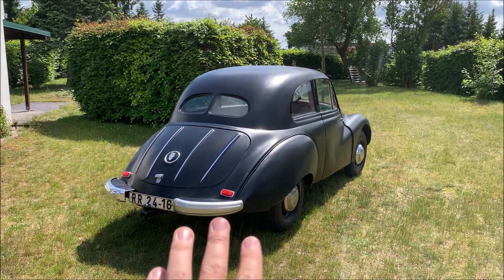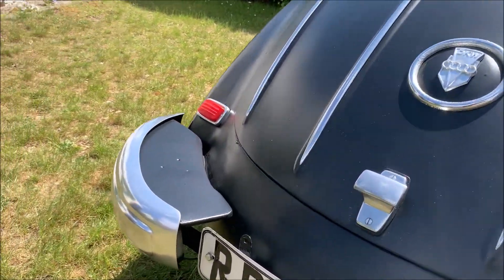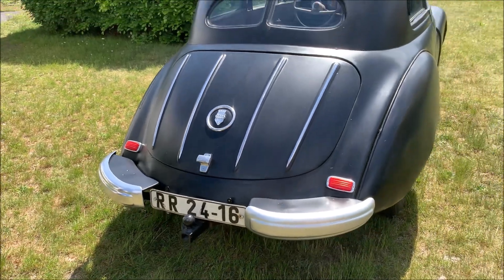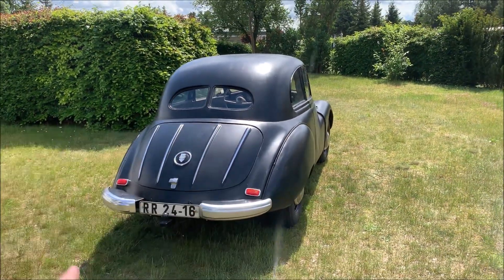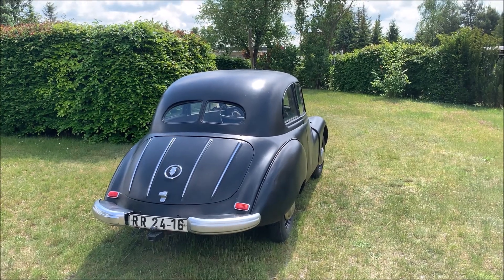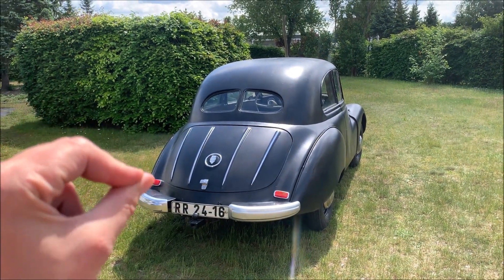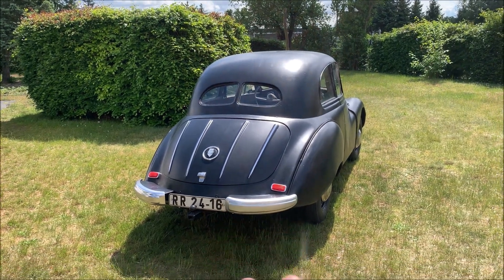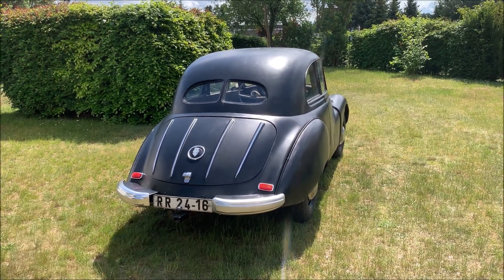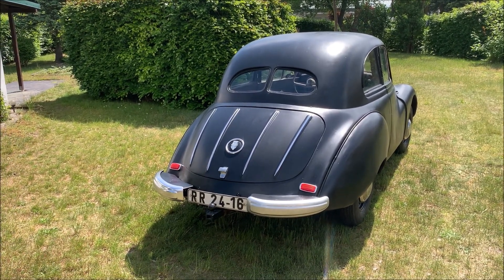Now we have the bumper on there as well, which is not that straightforward, because within the bumper are the license plate lights. Since it's a 1930s design, there are no ground cables — the ground is conducted through the whole body of the car. That means after you paint everything, you can't really get any ground to the components, so you need to rub off all the connection points. Additionally, it's a six-volt car, so if you have six volts at the front battery, maybe just 5.5 arrive at the rear. It took a bit of fiddling around, but it did work.